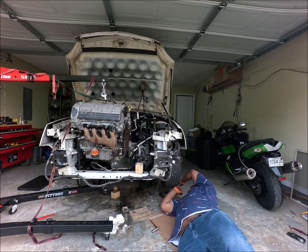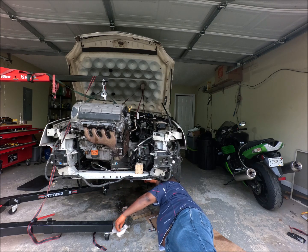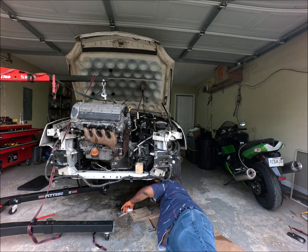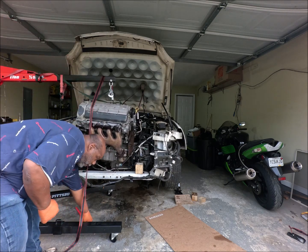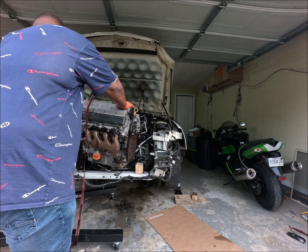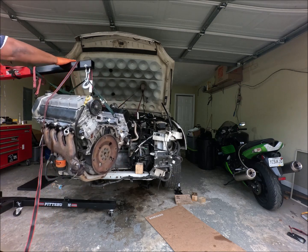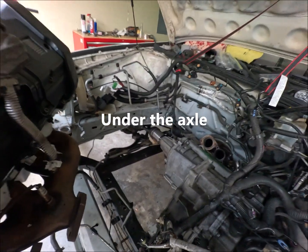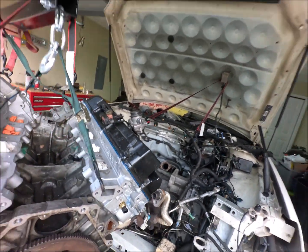It should go forward and come on out. Just don't want it to slide off the edge. Got the engine out again. That's the piece of wood I was talking about putting on top of that transmission. I may have to get another piece of wood, jack it up a little bit higher, and put that wood so the transmission stays pretty straight.